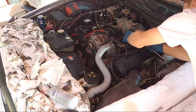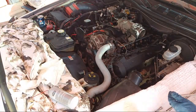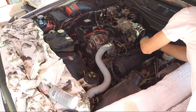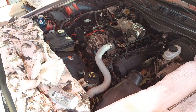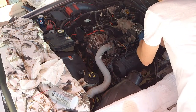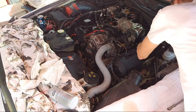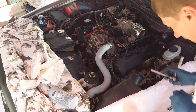So I already popped that one in. Shake this as you do it, then the bolts go in easy. And the fourth one, we can only get in with the small extension. So pop that in there. Okay, now they're all snug. Now we do the final tight. So we get all four loose snug, and then final tight. All right, one, two, three, and four.